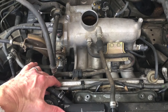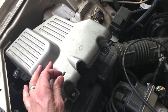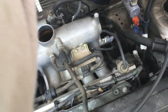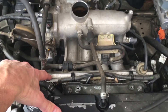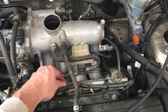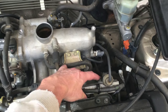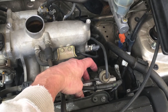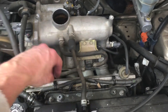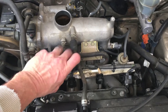I've already taken these bolts off, but you've got four of these holding this on here. Then you'll have three 10 millimeter nuts — three of them. You've got a screw in here, one here, and one over here, and this thing will start moving as you jiggle it loose. To get it completely off, you'll need to take off these two 10 millimeter nuts back here and here, and that'll free up this fuel supply, and then you'll have your whole rail off — but that'll get it loose.